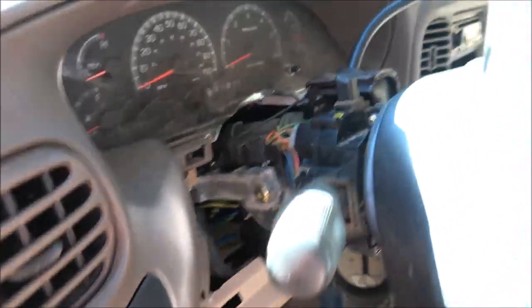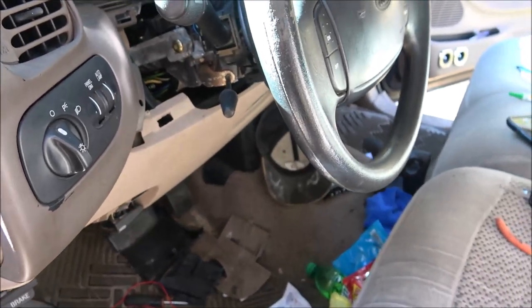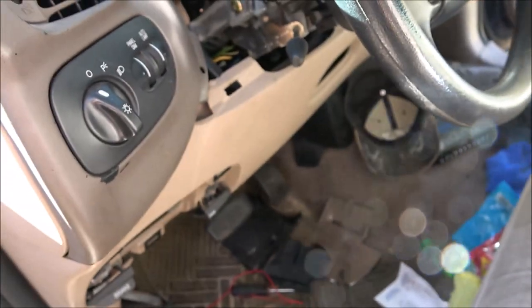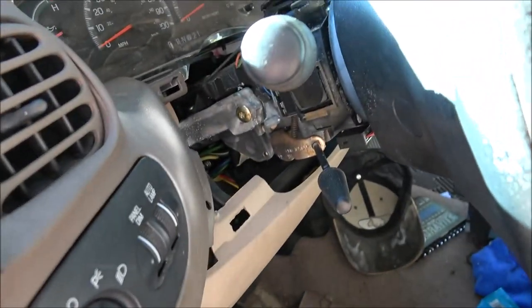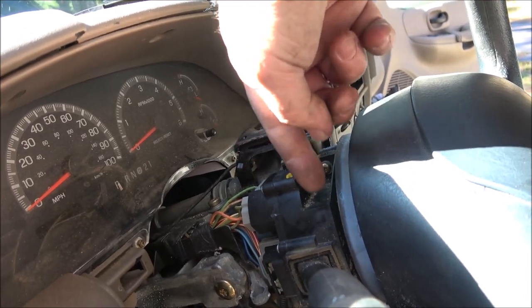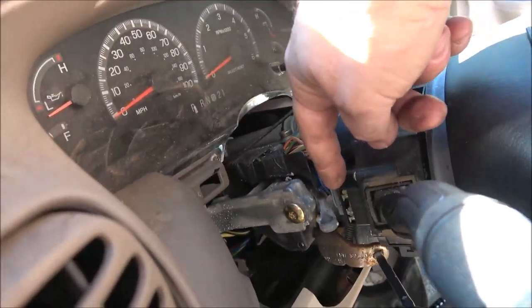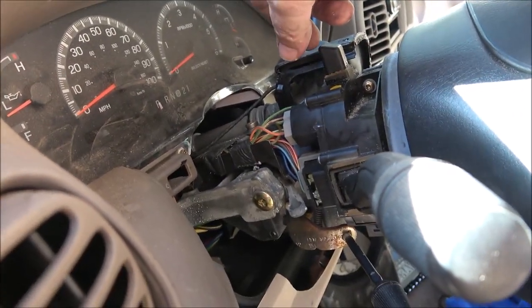That's going to be it on this one. My main reason to show you was: if your steering wheel is all the way down, try to raise it up and check that first. If that does it, that's your problem right in there. Then of course check your fuse. There is a flasher up and way underneath here - I've got to pull all this out to get to it. Usually when they go bad they'll kick on but won't flash, and this is not kicking on at all no matter how I run a jumper to it.